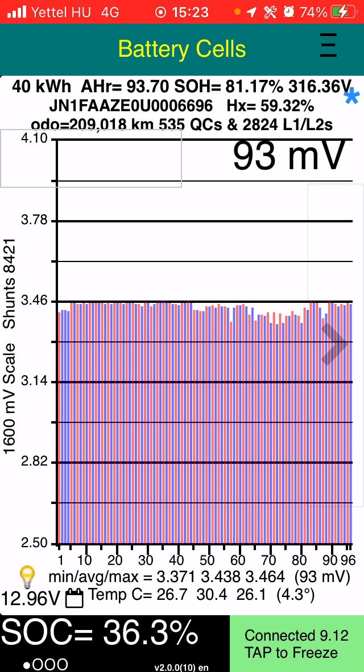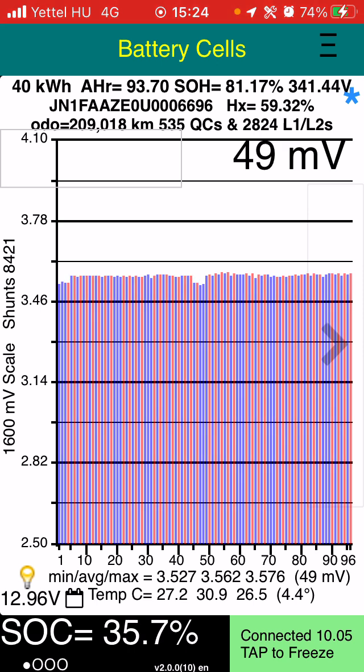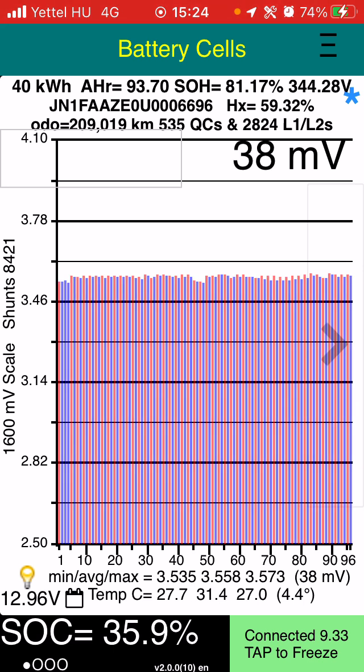And then it stays there, going to a maximum figure as we get lots of power on board. Now I'm going to have to shut off because I'm approaching the speed limit. We can brake for safety, and then of course the millivolt figure comes back to what looks like a perfectly acceptable figure — but quite clearly isn't, because there is degradation which only shows when you do a stress test.